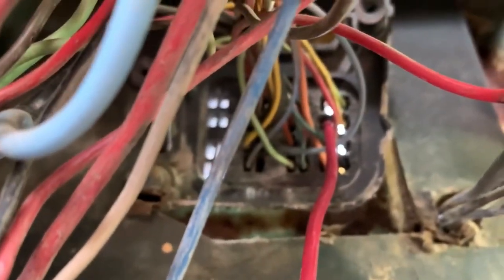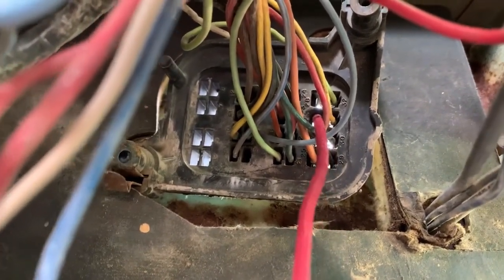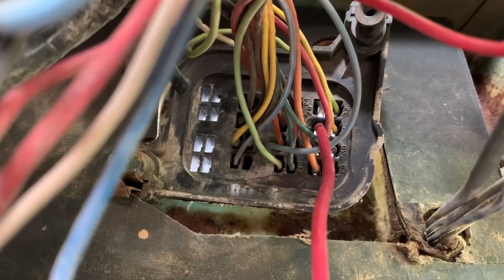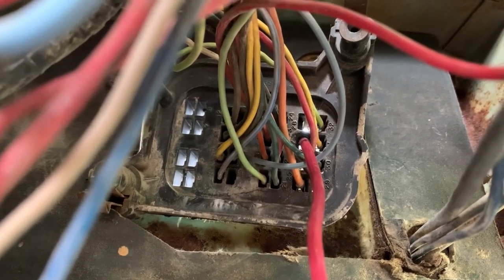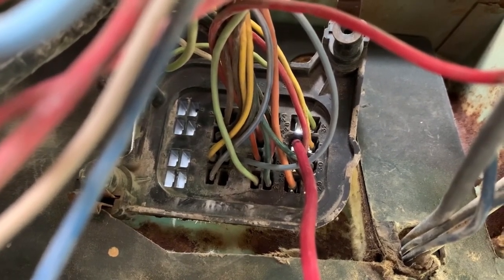You can kind of see that wire right there that I'm wiggling — that's the one I brought through. I'm just going to bring it all the way up to the back of the dash, and it's fused so we've got no worries. I'll tie anything I need into it. This will join up to the Mopar 'Jesus connection' — the big central point where all positives lead behind the dash. That's where this one will go, and it'll just handle everything positive behind the dash.